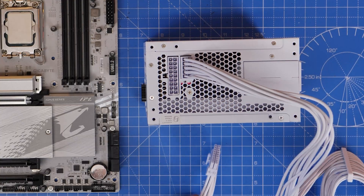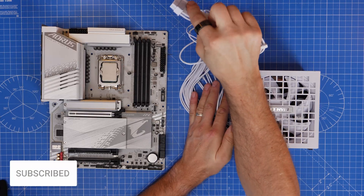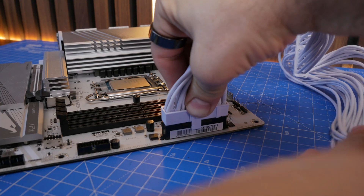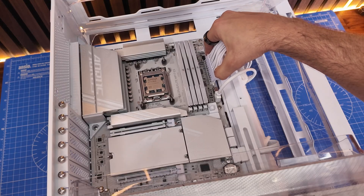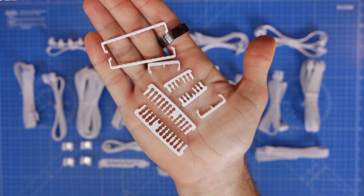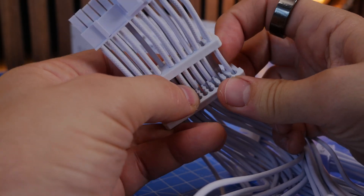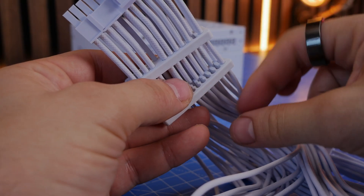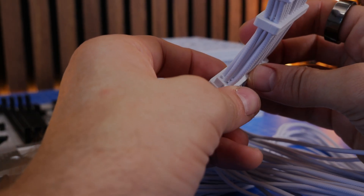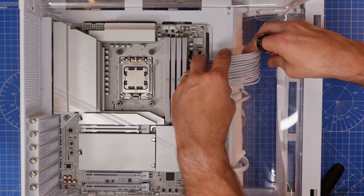Don't forget that you might want to put those plates in place over the top and screw them into place to block the holes — I'll talk more about that in a little while. The connectors will go in there and then the other end plugs into the right hand side of your motherboard. This is the same no matter what motherboard you're using. The 24 pin power connector goes on that right hand side — you'll see it has a little plastic notch on one side and that's how the cable clips over and hooks into place. Just make sure that's pushed in and firmly seated. You can use the cable combs to put onto the cables to make them even tidier. Work each individual cable into the comb, copying the one that's already on the 24 pin power connector. It is fiddly and does take some time, but it will allow you to neaten the cable up. You then put a clip over the other side to hold it all in place, and once it's in the case you can slide those cable combs around tidying up the cables.